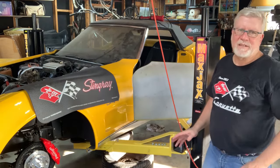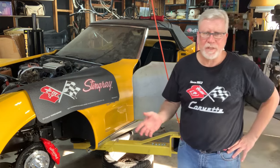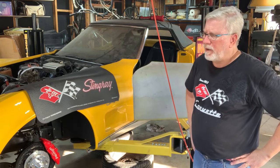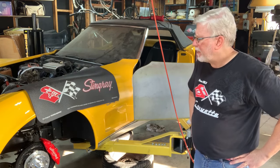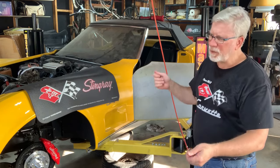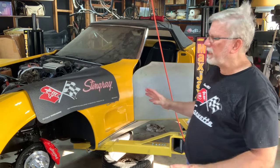Well, the brake bleeding is an ongoing process here. Gravity bleeding, if that's a viable option, I don't know how to do it. It's not working. It's just this continuous bubbles. I've watched it on and off for 30 minutes and it just doesn't stop. I did the fronts, but I tried doing kind of a hybrid method where I would push the pedal and have it blocked down, and then I would close the bleeder and pulled it back up. Anyway, I think I need another guy out here and then take another stab at it.